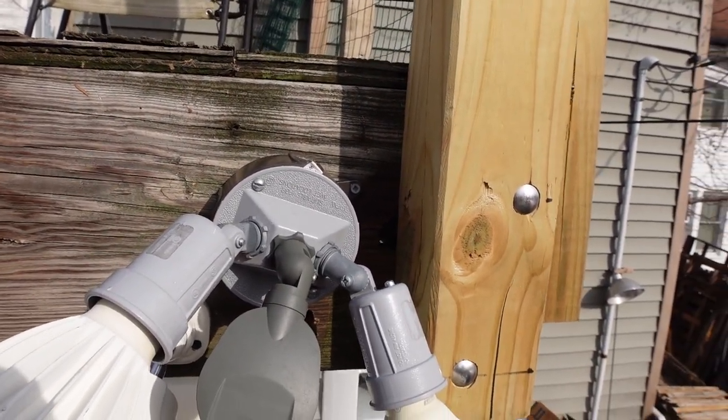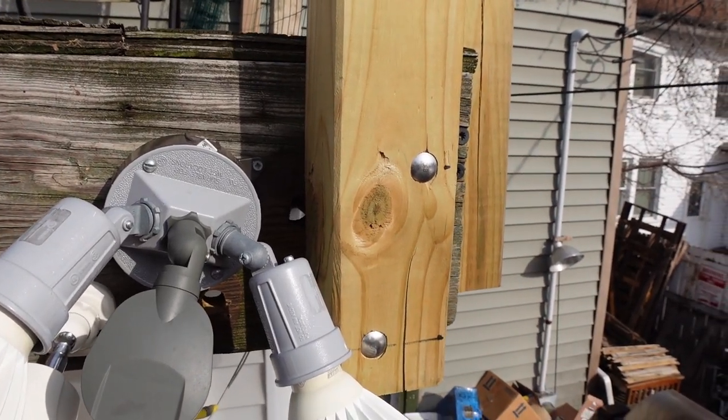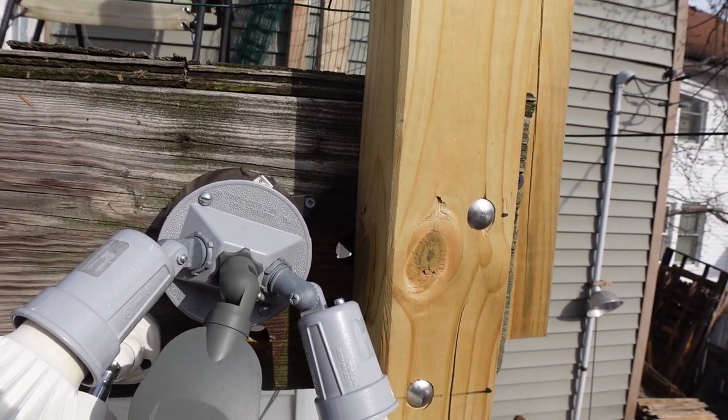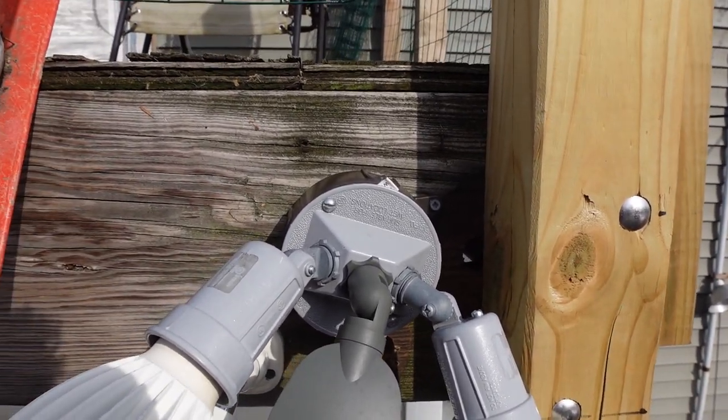Hi, it's Rob, and I'm up on the ladder again because I have to fix something. Something went boomy zap in this light fixture last night. Not sure what it is, but it seems to be some kind of a short. So, it blew the breaker. And then, of course, when I tried to turn the breaker back on, there was a spark, and luckily, Trisha was out here and noticed where the big spark came from, so I know that it's located in this light fixture.